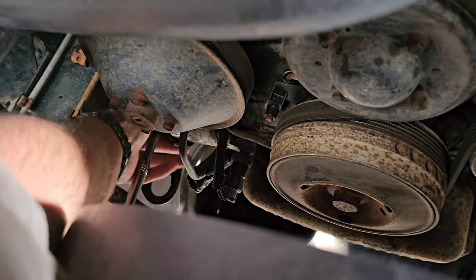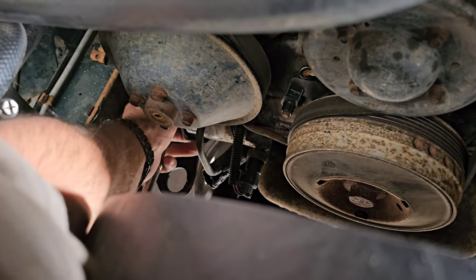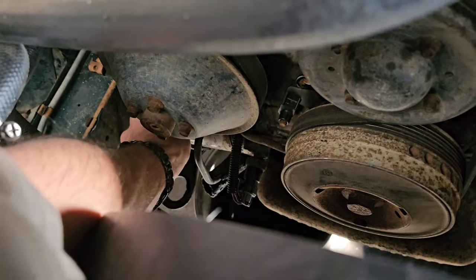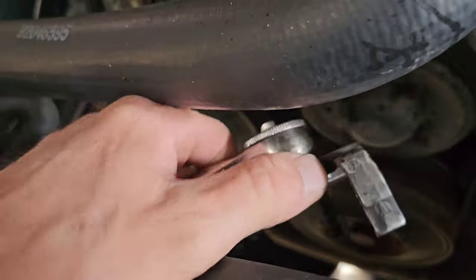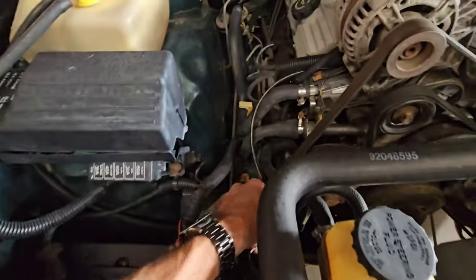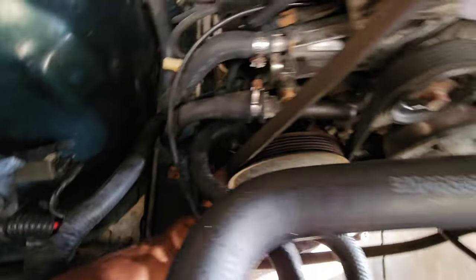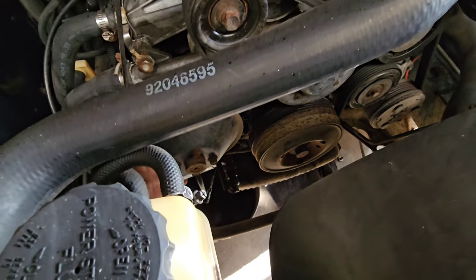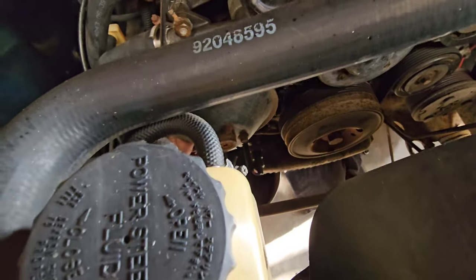So some oil filters, most mechanics know not to over tighten stuff. My car especially, and Helena's car, I service a lot of different cars, all the family's cars, and other people's cars, and I never over tighten anything. It's always a rule of thumb that an oil filter is done up to the seal and then about 3/4 of a turn.